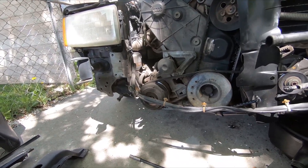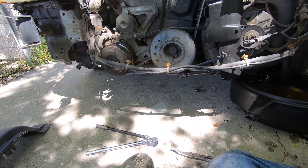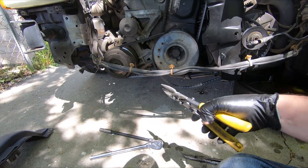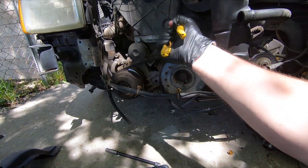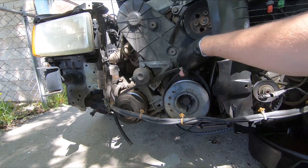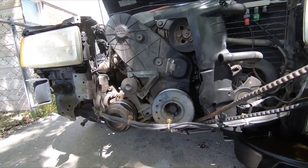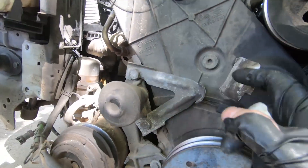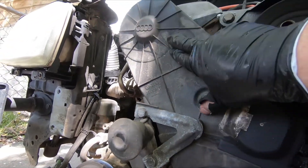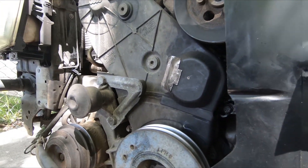The time lapse ran about 11 seconds so I may have done it too slowly. With the front end off, I like to just take something and chop the old accessory belts off since I have all new belts anyway. This frees up tension so the alternator isn't trying to spin while I'm setting top dead center. I'll remove this belt runner and the front cover bolts to access the timing belt.